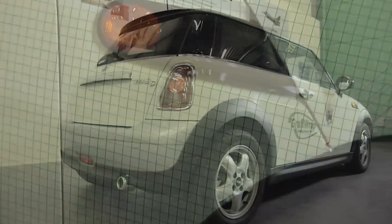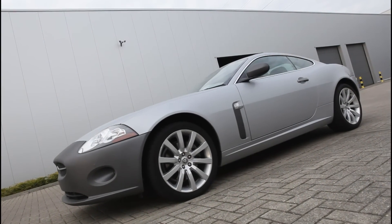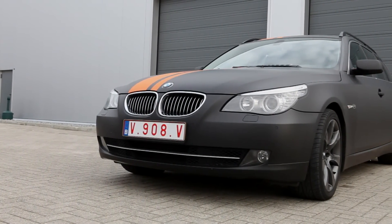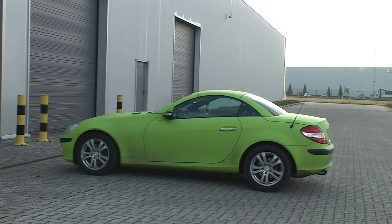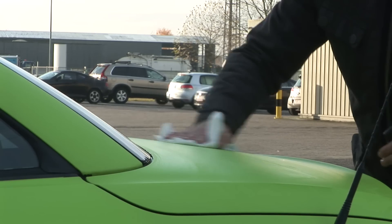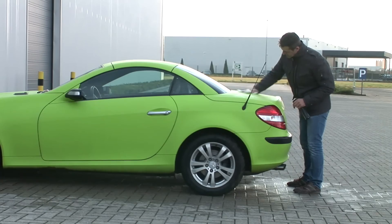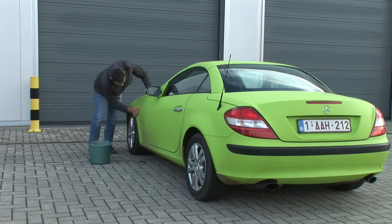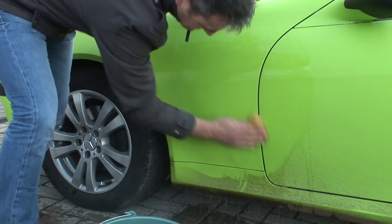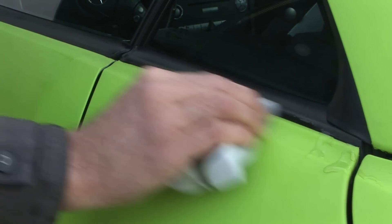An experienced wrapper will have a small car, like a Smart or a Mini, wrapped in about one day. A larger car will easily take two days or even longer. Matte and structured films attract dirt more easily than shiny films, and the dirt can penetrate deep into the pores of the film, after which it's no longer simple to clean. We therefore advise you to treat the film with a liquid polymeric wax immediately after the wrapping job has been finished. The wax will close the pores invisibly and give the film a deeper colour. To keep the wrap in pristine condition, the car should be washed with a good car shampoo containing feeding wax at least once a week. Stubborn dirt can be removed with water and a melamine sponge, after which the car needs to be waxed again. By following these guidelines, the film will stay in top condition for several years.